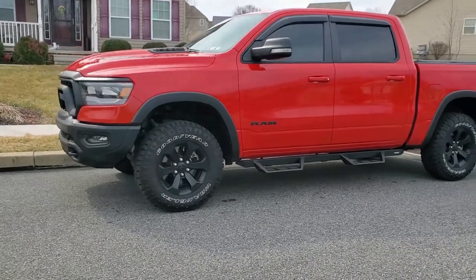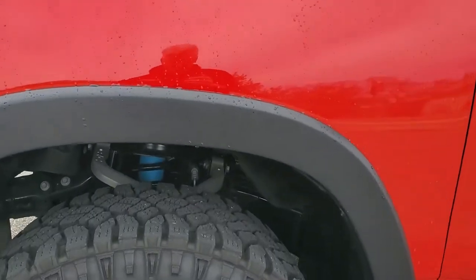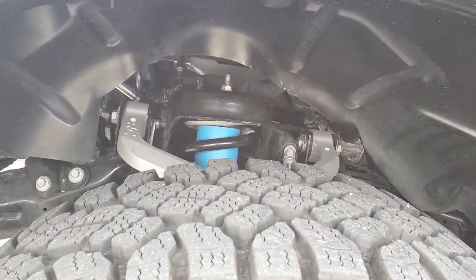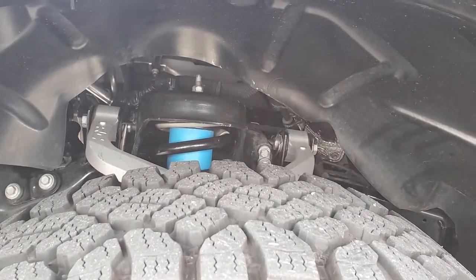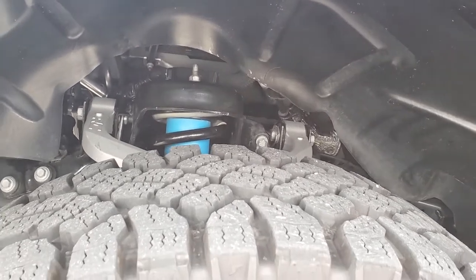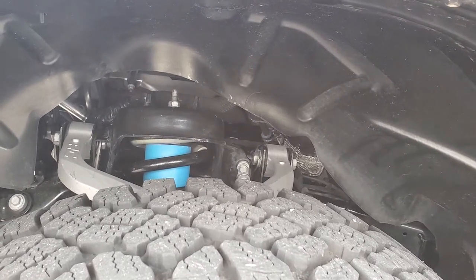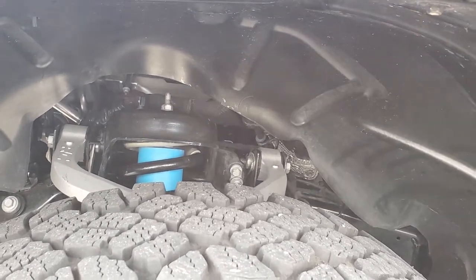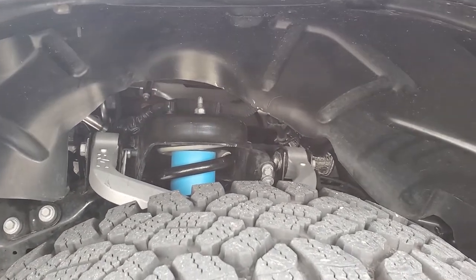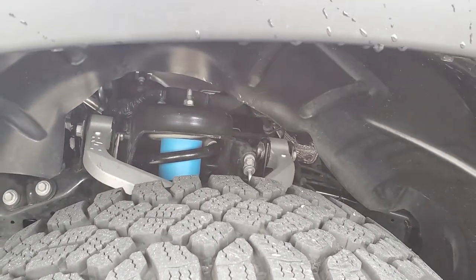So take a closer look, see how it looks from the outside, and there you go. You can see the top of the control arm. That looks pretty good, and otherwise it's really not that different when you look at it. So we're using the same dust boot and everything else. What I do like, it actually went together pretty easily. Torquing everything down was a bit of a pain in the butt once I had the weight on it, but all is well and good. But the end result is that at least that strut isn't pushed down, and I had zero coil contact or coil bucket contact. So we're good to go.